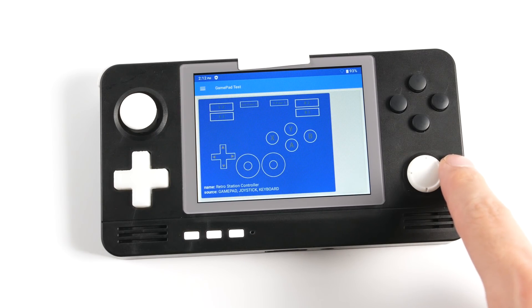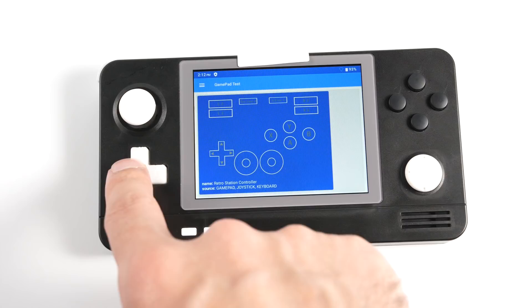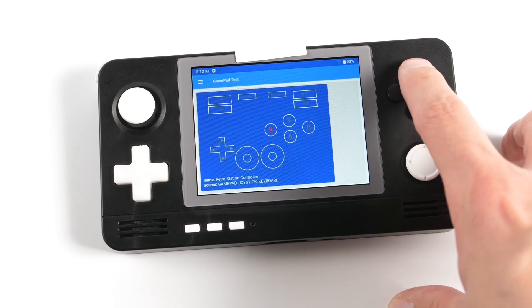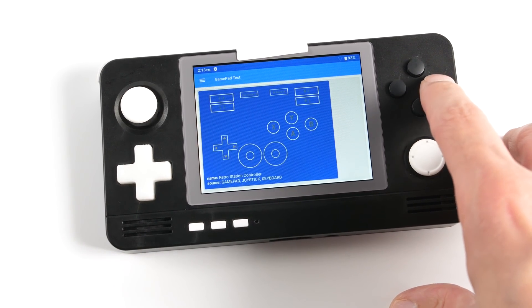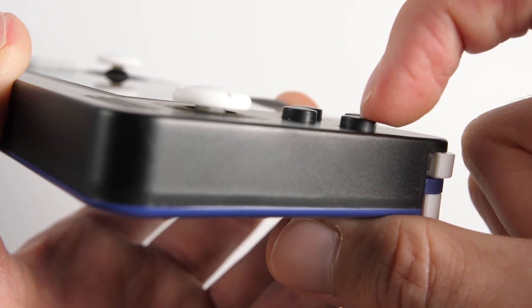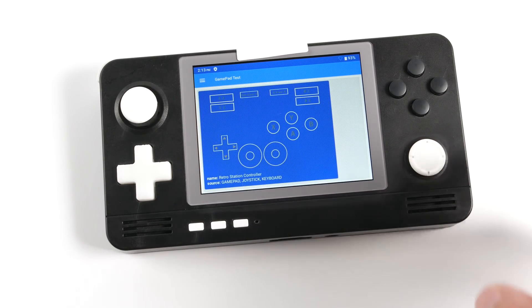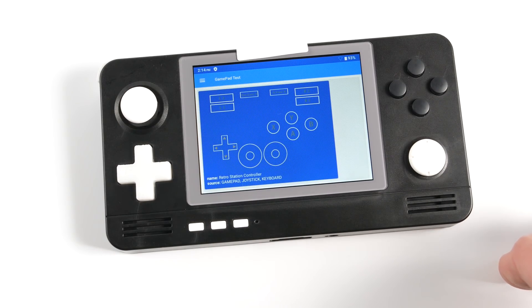The height of the ABXY buttons is already decent, so they decided to add height to the conductive rubber pad. They managed to fix the final issue in the prototype that I'm using now. The D-pad isn't perfect, but it isn't as unusable as it was before. The ABXY buttons also feel much better now that they don't have the ability to go under the shell. Even though this solution is better than the one they wanted to go with on November 22nd, Retroid kind of ran the clock and wasted valuable time. Changing just these two molds will probably take until December 10th. Retroid is planning on making an announcement that the Retroid Pocket 2 Plus is delayed, but I felt like you should have a bit more information since my insistence that they make a good product is partially to blame for this delay.